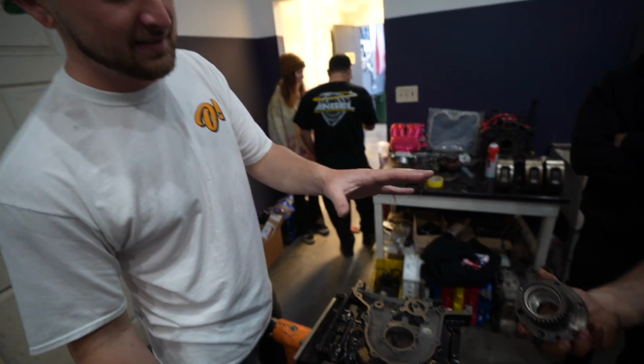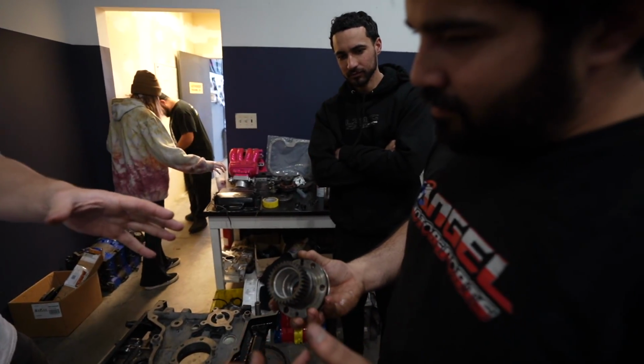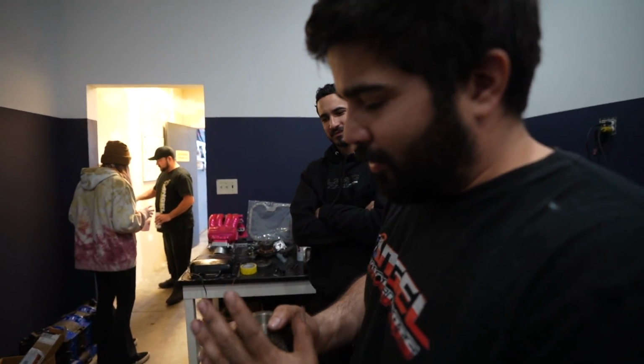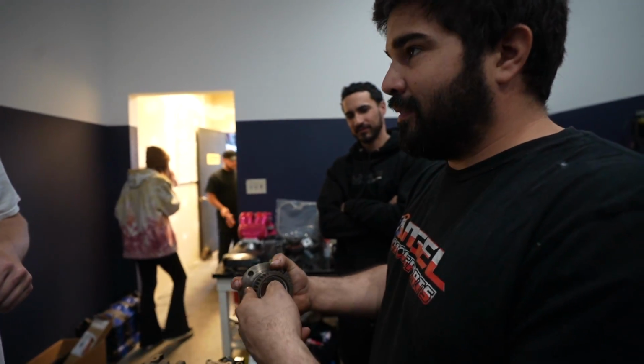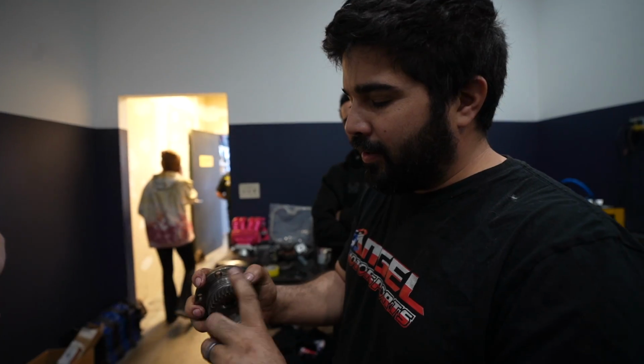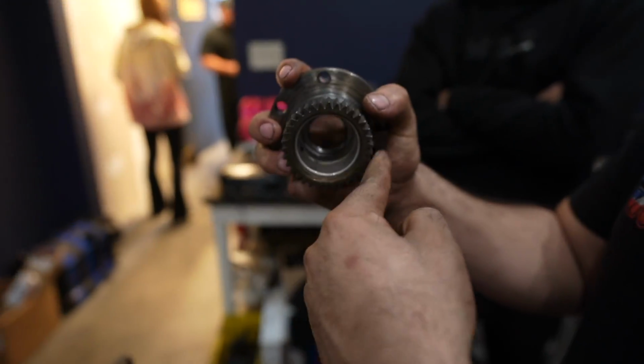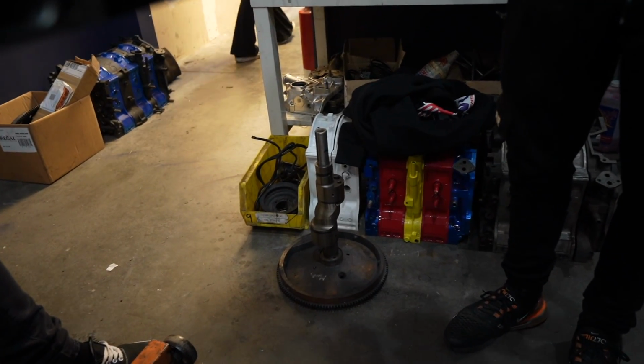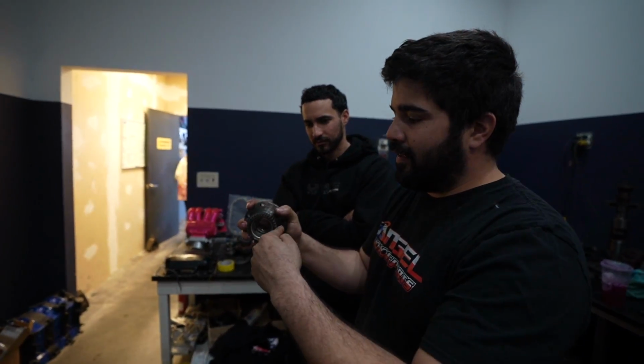So what is this? This is the crank pulley almost. I'm trying to put this in, like in a piston motor. This is the stationary gear. So the rotor spins on this gear. You saw the rotor has a gear on it. It actually rides on this gear. And the job of the E-shaft is to oscillate it around this.